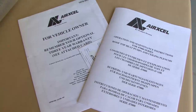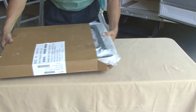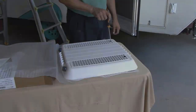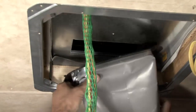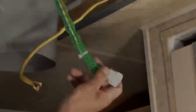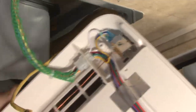The following step-by-step instructions must be performed in the following sequence to ensure proper installation. Carefully uncrate the ceiling assembly. Controls are factory installed in the ceiling assembly. Remove the grill and filters from the ceiling assembly. Fasten the duct collar to the base pan of the air conditioner with the three screws provided. Plug the rooftop air conditioner electrical conduit into the nine position receptacle located in the thermostat side of the ceiling assembly.